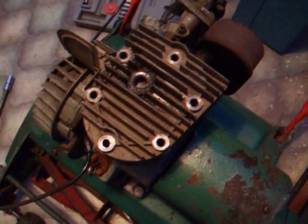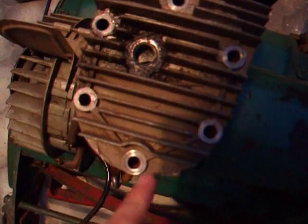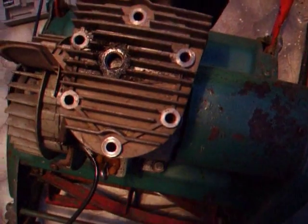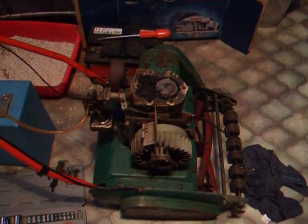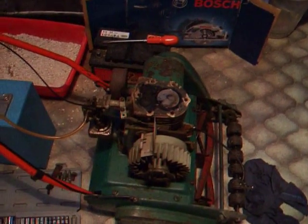All the bolts for the cylinder head are now out - they came out all nice and freely. I laid them down in the order they came out. When I put them back in I'll cross them over. After a bit of trouble I got the head off. It didn't come off as nicely as the 5 horsepower ones, but I got it off in the end.